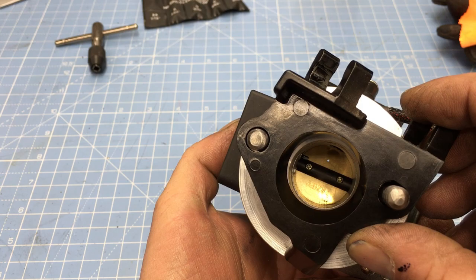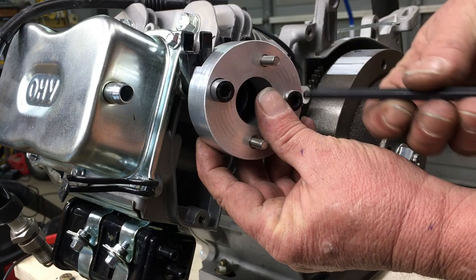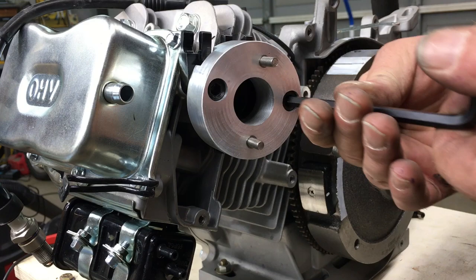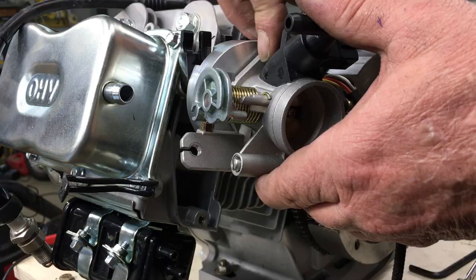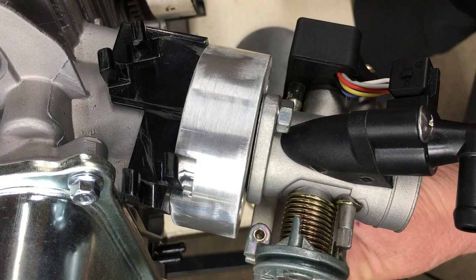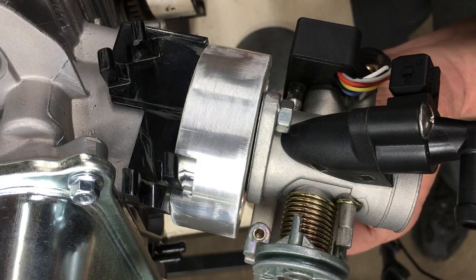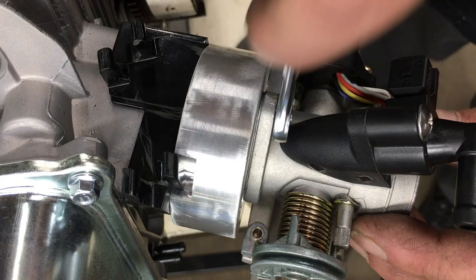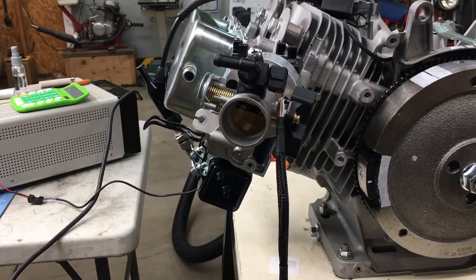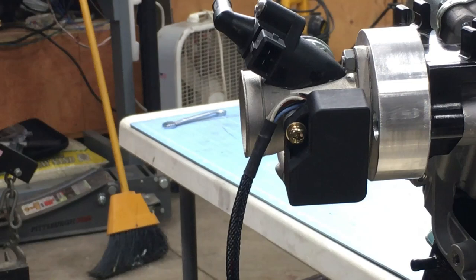The best part of making something is putting it all together at the end. The adapter fits the engine really well, and custom-made parts will do that on occasion. The two hardest parts of doing this fuel injection conversion are pretty much done — the rest of the system should go together pretty quick. The alternative mounting of the crank position sensor is not a half-ass fix — there's actually a reason I did it that way, and it will be more clear in future episodes. I could have easily ordered the custom sensor, but eventually I was going to move the sensor over to the other side anyway, so problem solved. Well, I think we made some real progress. Go ahead and enjoy the rest of your day, and thanks for watching. If you enjoyed this video, click like and it would really help me if you clicked subscribe. Until next time.